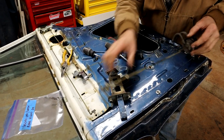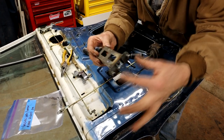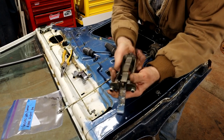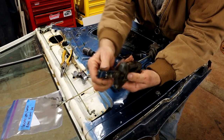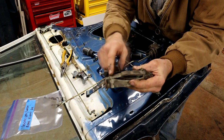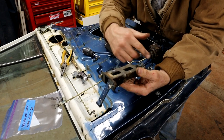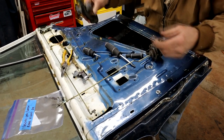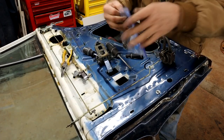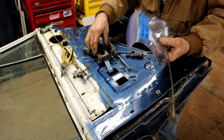And to pull this out, you have to take the check strap out. This is the check strap, two bolts here, one bolt here, just three, it comes straight out. Really nicely, heavily made check strap, look at that. Can take the opportunity to lubricate that. Got a really nice design, very heavy, strong spring here, so something I can lubricate now that it's off. So that's the diaphragm off. Again, making sure to label everything because it's going to be some time until this door goes back together. So those parts are out of the way.